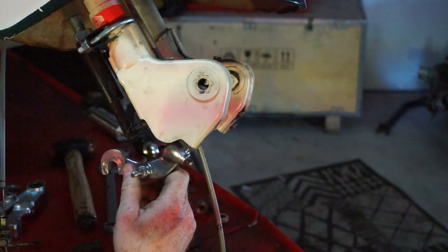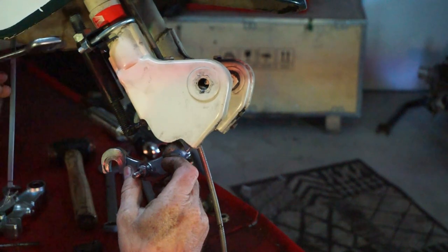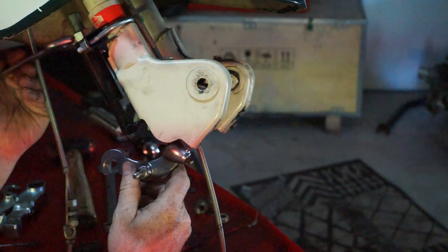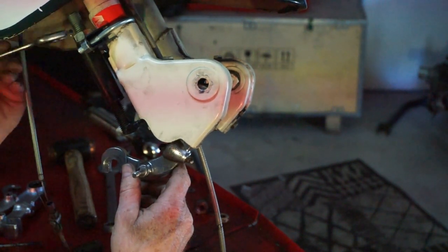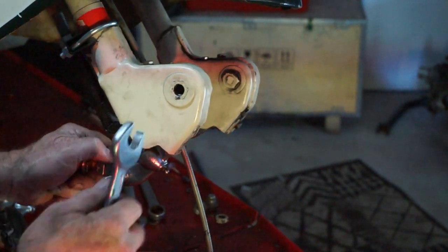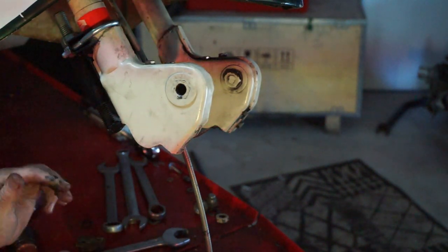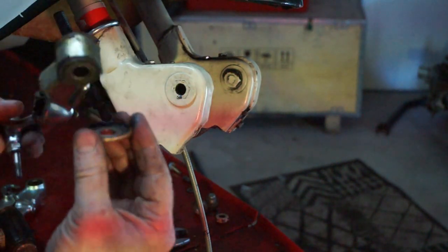Enough yet? No, it's got to go a bit more. Keep going. You have to wind these up a bit more because they haven't got the separate ball like the GPs have. GPs are much easier to work with. Just take the big fat ball bearing out and you've got loads of clearance. Thank you. Out it comes. That's one leg out. So that's that nicely leg removed.